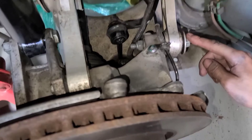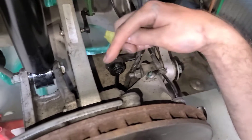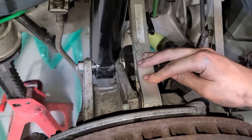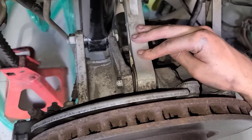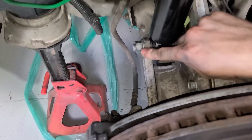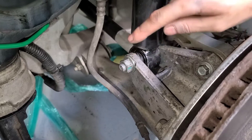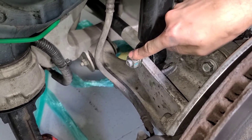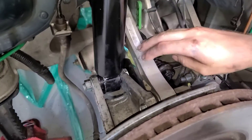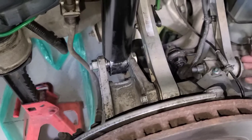We're going to torque this bolt to 130 Newton meters; if you're using anti-seize, torque this to 91 Newton meters. For the upper arm bolt, torque to 98 Newton meters with anti-seize, or 140 Newton meters without anti-seize. This bolt right here: 98 Newton meters with anti-seize, or 140 Newton meters without. Notice that the nut is on the backside of the car, not the front — if you put this on wrong you can accidentally clip this arm. The shell side goes on the side of the arm, so be careful of what direction you put this hardware in while doing the strut replacement.